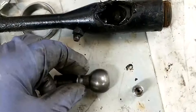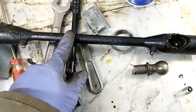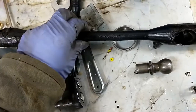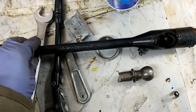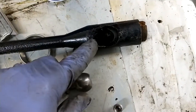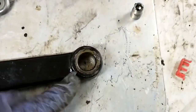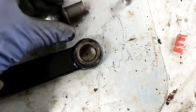I was reading some more and the later trucks — like '53 and above I think — got rid of this multi-piece design and started using a more modern one where the balls are integrated and they screw on. These are pressed on, and every article I read said they are a monster to get out. And this one was.